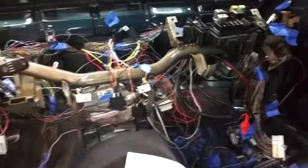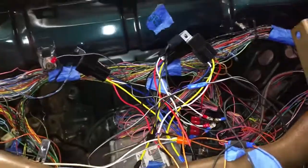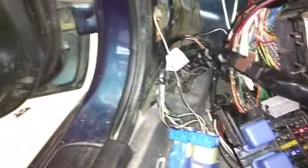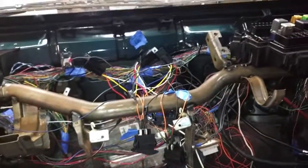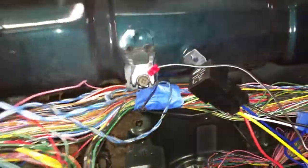So that's where I stand. I'm going to get all the wires hooked up — it's pretty straightforward, only a few wires needed off this plug. The fuse box needs a home for the relays. One big thing if you're making your own harness is finding a place for grounds — I have them scattered around right now, and I still have to properly ground that fuel pump relay. Finding a good home for grounds is important; that gave me a lot of problems early on because I just had it temporarily hooked up.